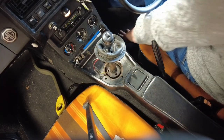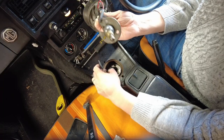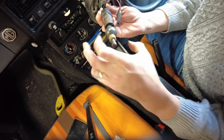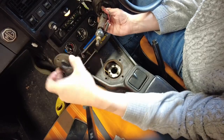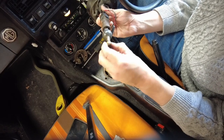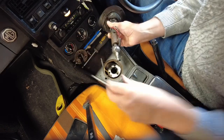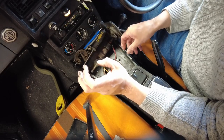I'm just going to take a picture on my phone so we know which connector goes which. Now look at that — we do have a bushing but it being up there is not much use; it's supposed to be down here. I actually bought a new bushing. See, that's supposed to be on the ball joint — so that's the cause of the play: the bushing was not present at the ball joint at all.